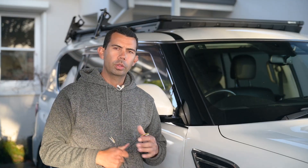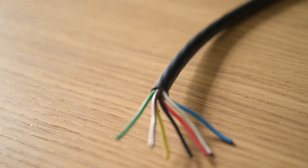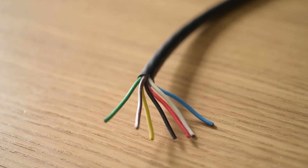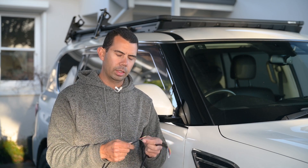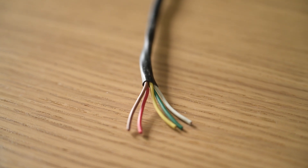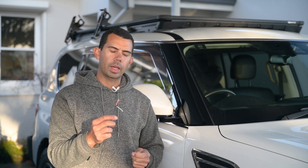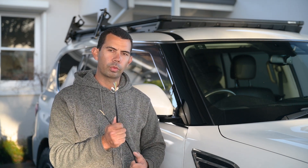The wiring I used was pretty simple - I didn't want to be running heaps of cables throughout the car all messy. I went and got a seven-core, which ran from the switches up to the roof rack. Then within the roof rack I ran a five-core - I wanted a three-core but they didn't have one at the time. The five-core was just to extend the cable from the lights to the back where the seven-core came into the roof rack.